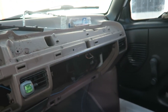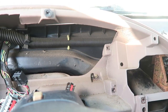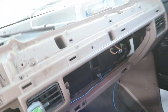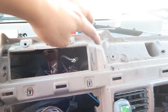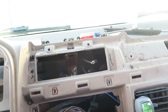It's been about an hour and a half, almost two hours, and this is the progress so far. Removing the actual cluster right here is not too bad — you just remove those two panels, they're screws, and the whole trim around it comes off. Then the cluster is held in by four screws and it comes out. The one that was difficult to get out was the piece that goes right over the radio. The glove box has seven screws that screw into it from inside. Getting the last two was a pain — I had to remove the radio, which is right there, and it popped off easily after that.